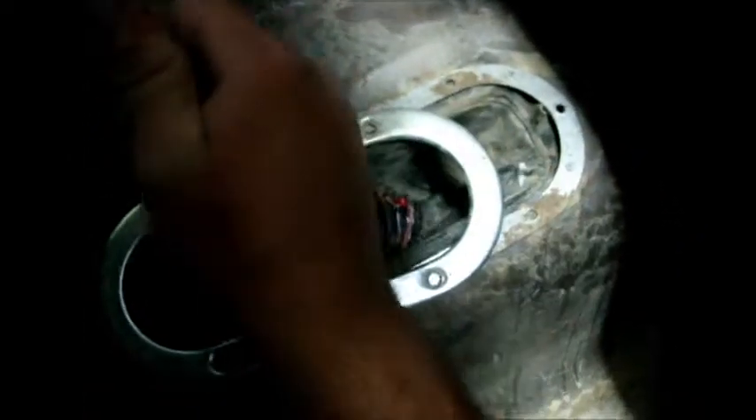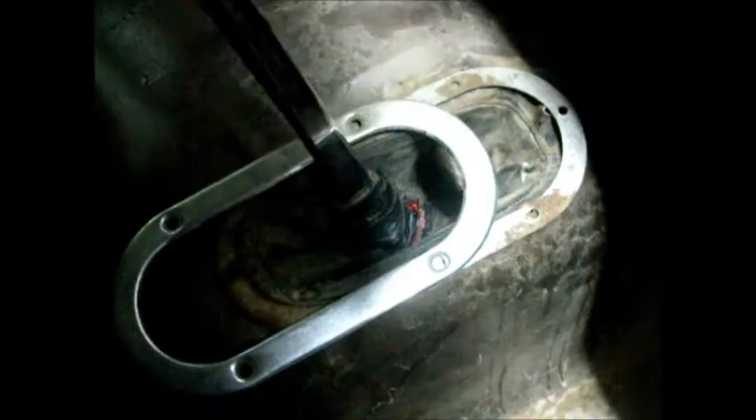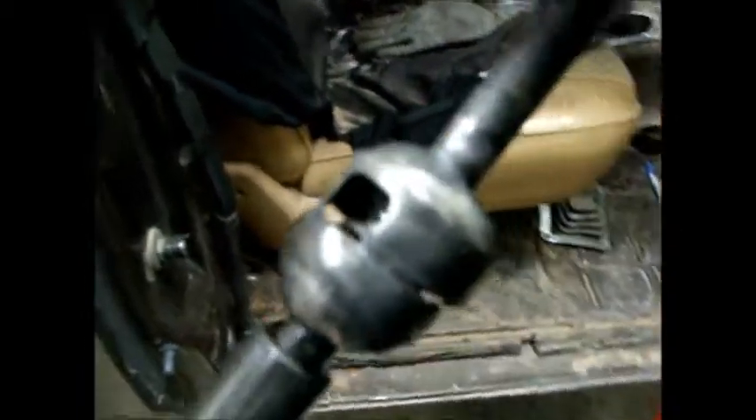There are things — gaping hole in the floor, transfer case shifter, the shifter for the tranny. All you gotta do to get them out — that plate right there, just push on it and twist and that plate will come up, and you can just pull the shifter right out of the top of the tranny.